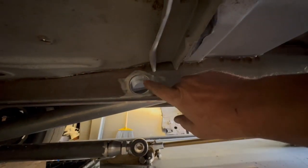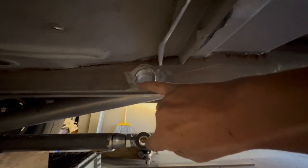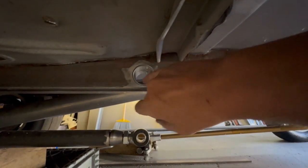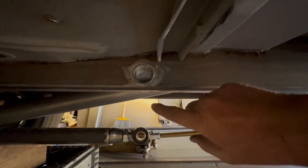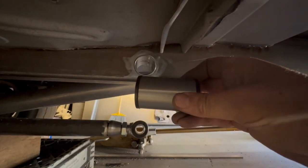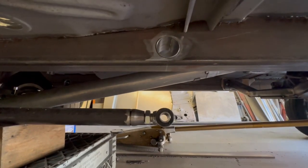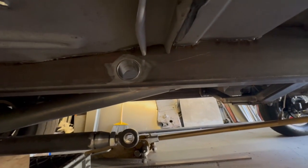I need to figure out a shackle situation — I'm calling it a shackle, or a pivot point if you will. It's long enough now that I don't have to worry about changing a whole bunch of pinion angle or getting any rock out of it. I was worried about it being short and doing some weird stuff. Get this welded in, get the bushing in, figure out what I'm going to do for the pivot. I need to go get some longer bolts since I did the change of plan — these ended up being three inches. This is inch and three-quarter, so I have to do something down here on the bottom to make up that gap, whether a spacer or kicking the arm or whatever.